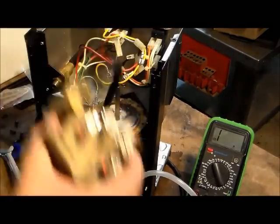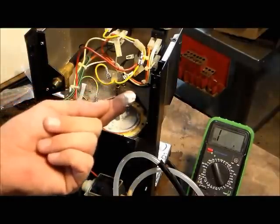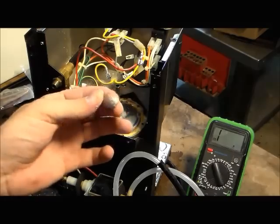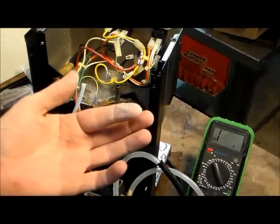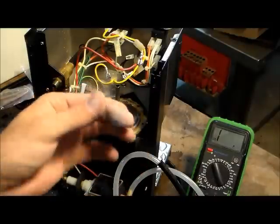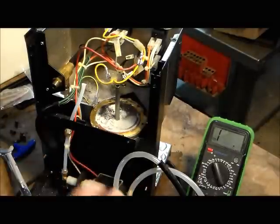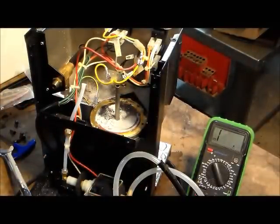That's the confirmation — that is visual confirmation. This white powder right here, that is your white porcelain that insulates the heating element. You can see how it's a little dry once you wring out all the water from it. And if this customer was ingesting that, that's probably very, very bad for his health. So we're going to go ahead and really give that a good cleaning, wash it all off, replace the O-ring for the gasket, and put this customer back together and send him on his way.